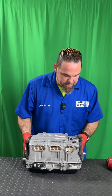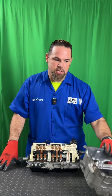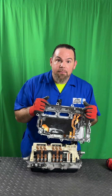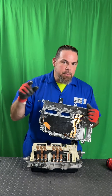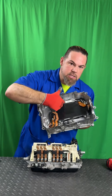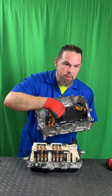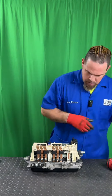Now let's open this up. Inside the inverter assembly, we find the main capacitor — and this is exactly why you need safety protocols in hybrid electric vehicle training. This large capacitor filters and smooths the high voltage coming from the battery so it can drive the electric motors and high voltage components smoothly. Every time you shut down the vehicle, a discharge protocol uses a charge resistor to create a short circuit inside the capacitor, discharging the huge amount of power this unit can hold.